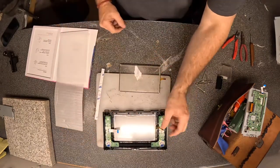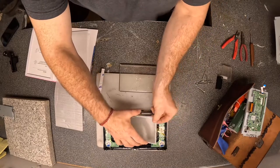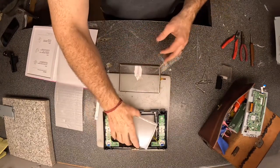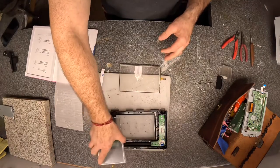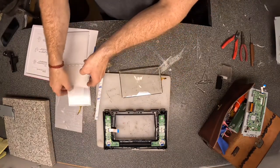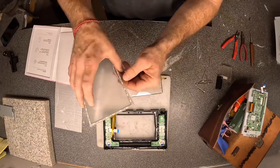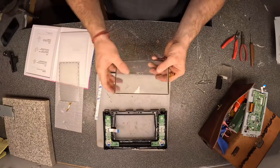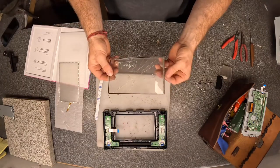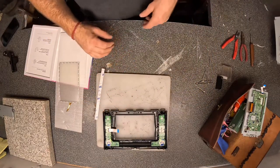All right, so I'll get everything cleaned up and the plastic pulled off the inside and the outside, because if I don't, it'll be wedged in between the plastic molding. So get that cleaned up and then basically do the reverse of what we just did. Start plugging in the ribbon cables, and this two layers as well. The plastic protected on the top, and then the digitizer on the underside. Interesting. All right, I'm gonna toss this, get going with cleaning stuff up, and come back and put it together.